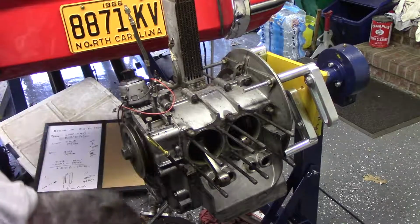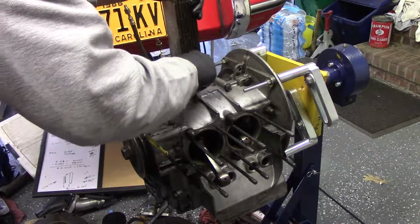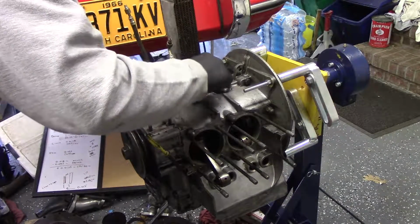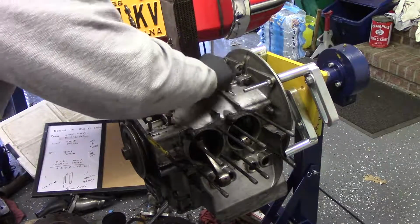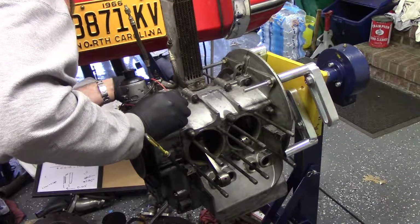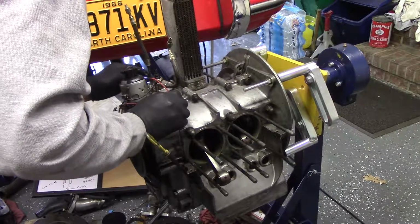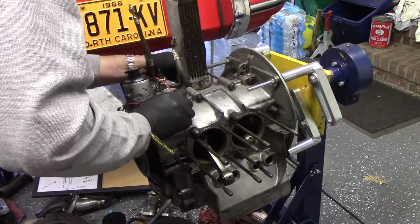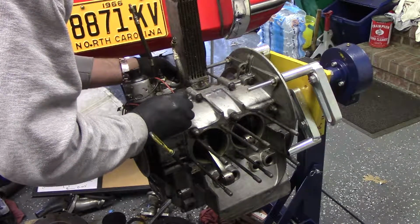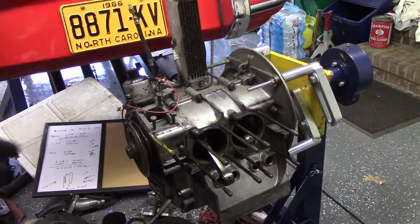So, next we'll go after the oil cooler. It's 10 millimeter nuts that hold this on. And it may or may not ooze everywhere, I don't know. If I had to plan this and have all the right tools out, apparently I forgot the quarter inch drive ratchet and the 10 millimeter socket. All right, so that'll take forever. That's how the oil cooler comes off.